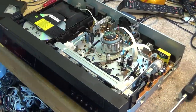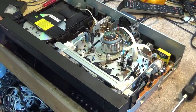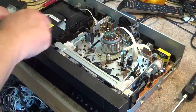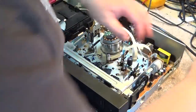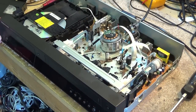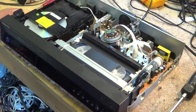It's a pretty basic VCR, typical Samsung type. The rotor is actually on top, unlike other VCRs which have the motor below the chassis. A lot of these later generation VCRs were built this way with the motor coil assembly and rotor on top — it makes things a little less expensive to manufacture. It's not accepting a tape, so we're going to power this thing back up and see why it's not working. It looks like it might try to load now.